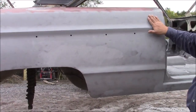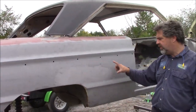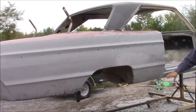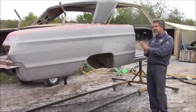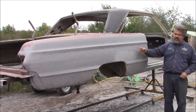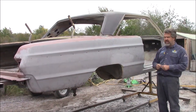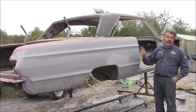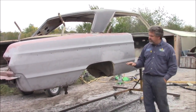You can see — and you can't really tell on the video — but these panels, this is a really long quarter panel and a really long section here. There's absolutely no warpage, no damage to the body whatsoever. By media blasting this body as opposed to many hours of sanding, this in my opinion is definitely the way to go — it certainly doesn't hurt the metal.